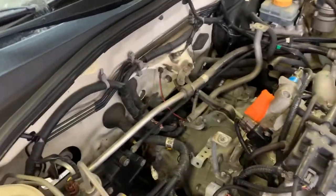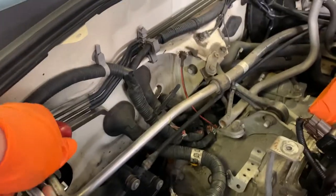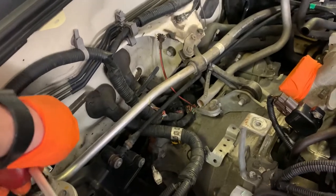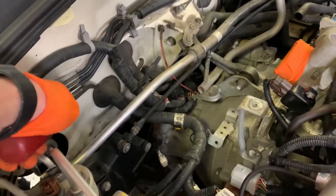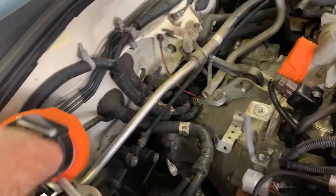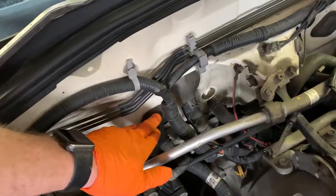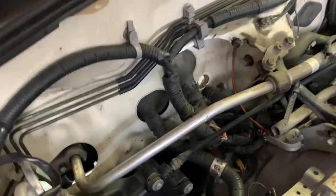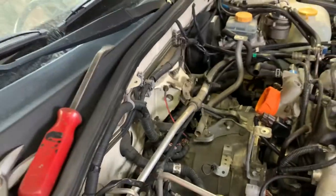All right, so what I do on this side is for these grommets, take a tool like this. I don't know if I can get one-handed, but just kind of get it started going in there without, you know, poking into the wires or anything. Get it started, push that grommet through all the way around. Same on this. So I've got this ready to push through with that grommet, and gonna cut these, and then we're gonna have our harness, which is pretty exciting.